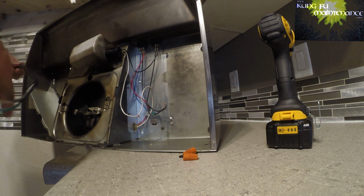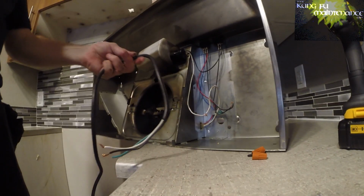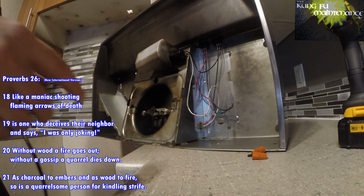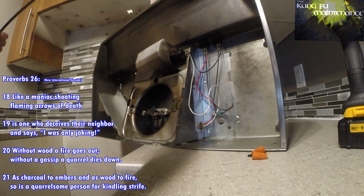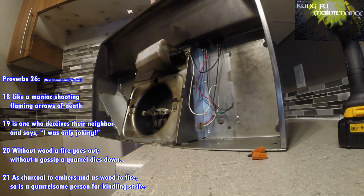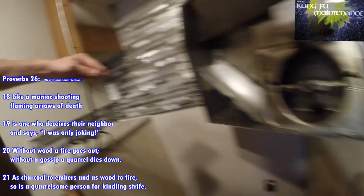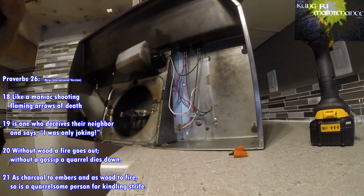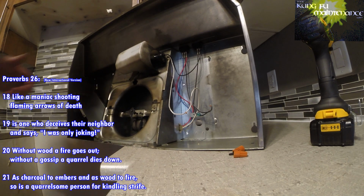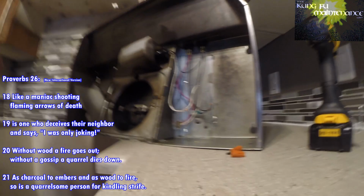I mean, it's not like it's going to go anywhere, and this cord has strong insulation. But it's still more correct to have the strain relief. It just anchors the cord in there, so no problem. They also didn't even connect the ground wires. We'll make that better. And it was actually a stove fire on this one. It wasn't because of that, but yeah, it was toast.